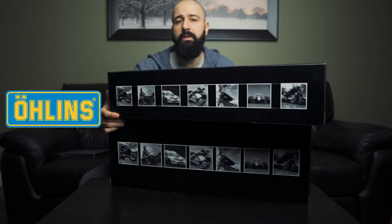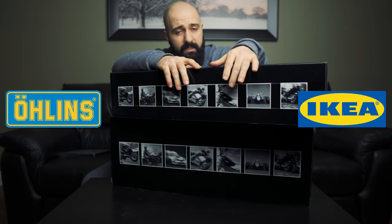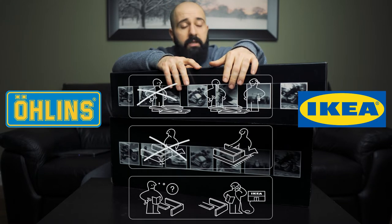My goal for the project Miata is to build a capable street car that I can take to the track pretty often and have some fun with — nothing too crazy. So I went for a set of Ohlins road and track coilovers. It has one-way damping adjustment which controls most of the rebound, which is all I need. Independent height adjustment because I like to set my preload and then adjust my height to wherever I want. And no camber plates because they're pretty much useless on this car — all the camber angles I want I can get from the control arms. Ohlins being a Swedish company, just like Ikea, came in multiple boxes and some assembly is required.